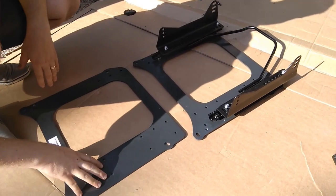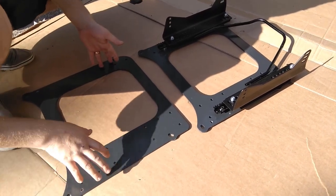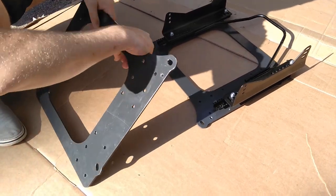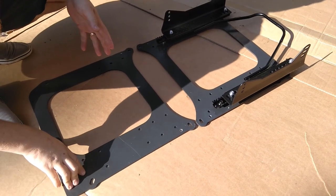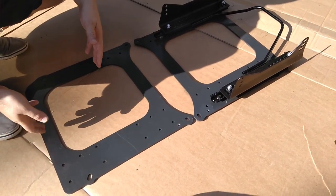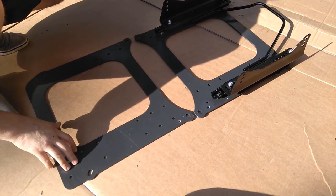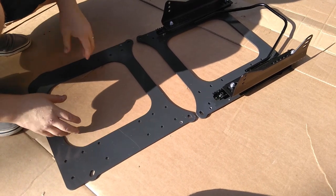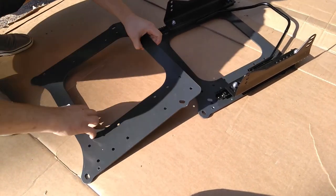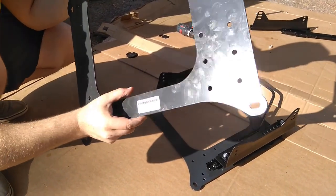This orientation is for the left-hand driver's side. I've tried it the other way, but then if you have shorter drivers there's not enough slide on the sliders for them to reach the pedals or steering wheel. So the right orientation is like this. These brackets are from raceparts.cc — I got them off eBay; they have a store there. What I did is I modified this a bit: I drilled two new holes — one here and one here — for these parts.